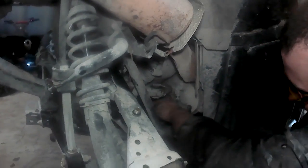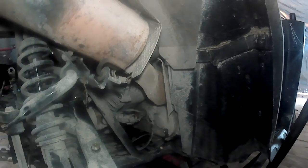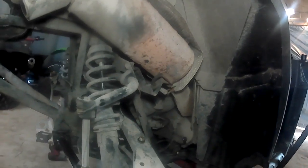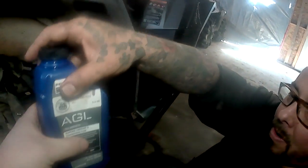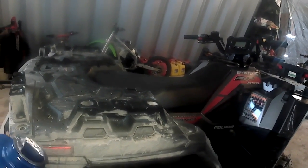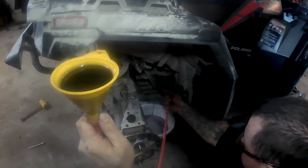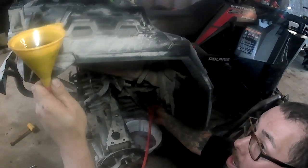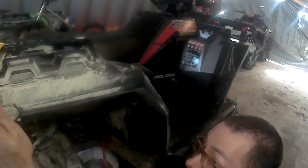It's an O-ring base seal — you don't have to torque on it, there is no point in that. You're just going to flatten your O-ring. You don't want to do that. So there's the old AGL — same as the rear differential. We're just going to fill it up until it comes out the fill again. Maybe — oh, there we go. I just had the hose in too far, I was blocking it.